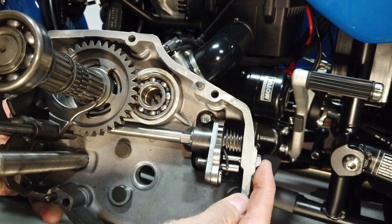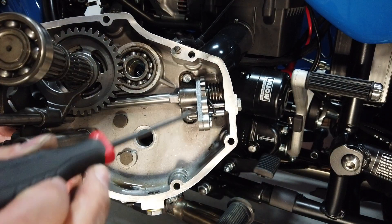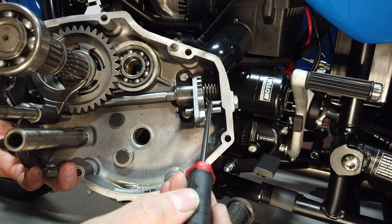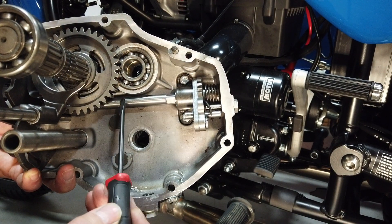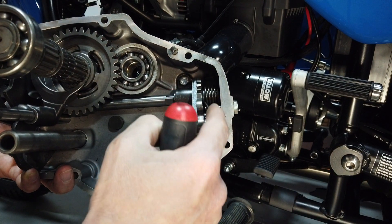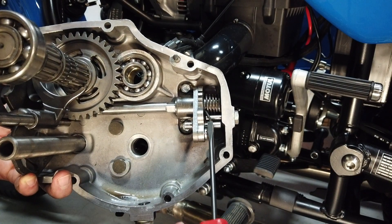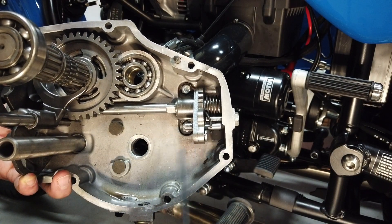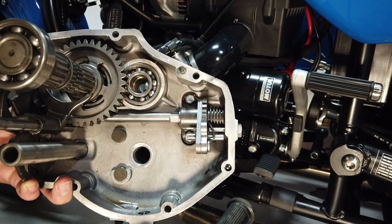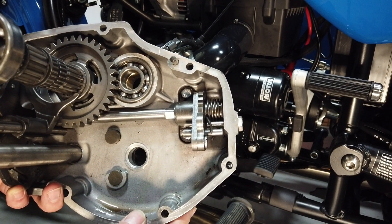If you peer inside, you can see that that bolt is actually used to keep tension on the double tail spring that goes to the shifting crank, which is attached to the shift shaft and the shift quadrant. So if you were to back that out, what it does is release the tension that it holds on the spring when it's activated. We're talking costly repairs — they basically have to go into the gearbox and set that all back up again.